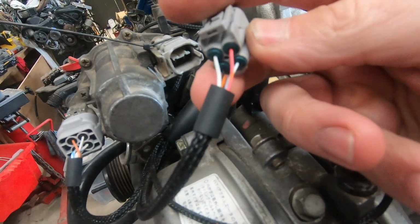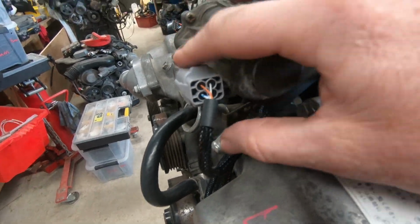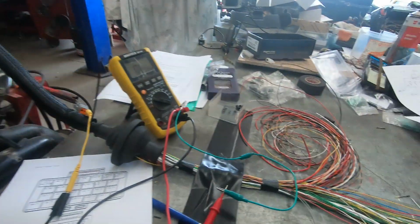I've got the pinouts for that plug. And the motor plug is here, which also has a little clutch unit in it. I'm going to strip off the shielding and join them all together and earth them. That's going to take me a few minutes to do that. I'm going to do it to all of these wires. I had in fact already gone through and continuity tested them, and I've written on each wire what they are. As you can see, it is a little bit of forward thought. I might have done one or two of these.